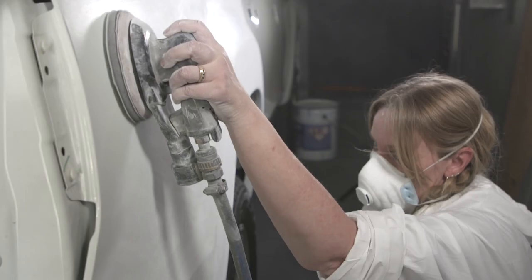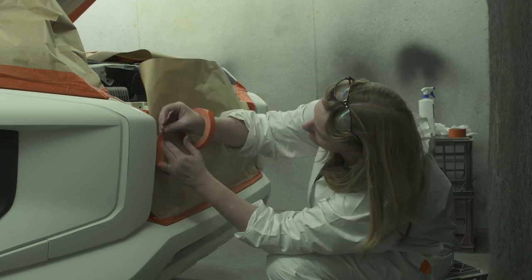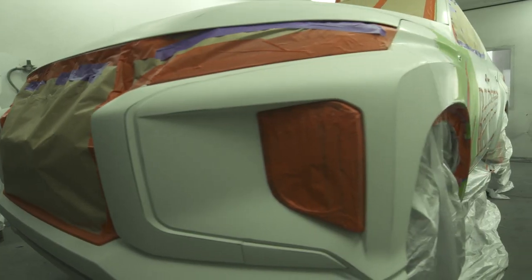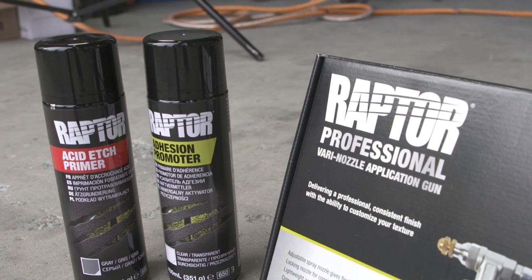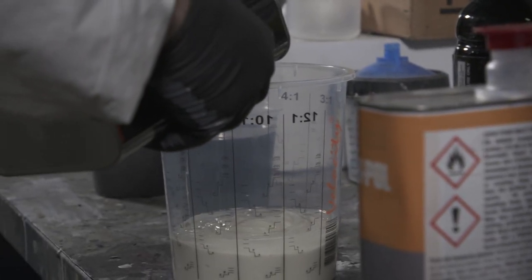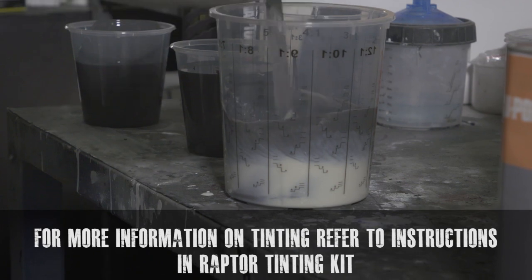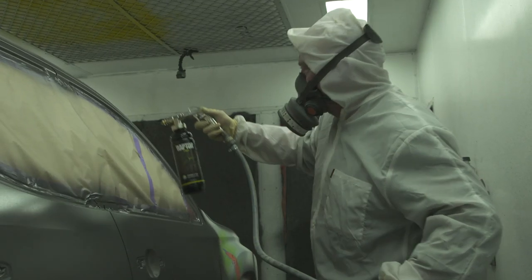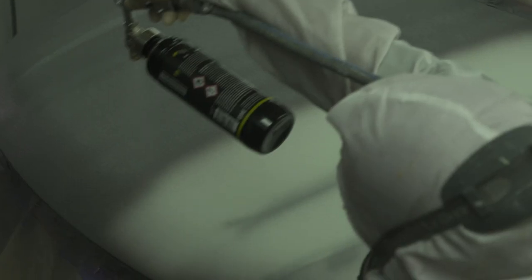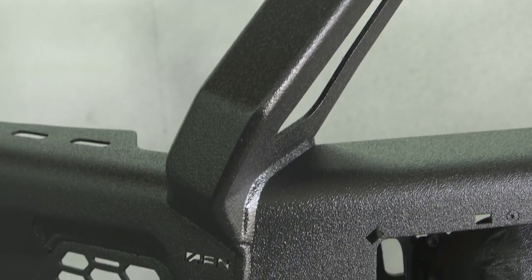Just like the bar work, step one is to strip the car down and tape up anything you don't want coated, then get to work preparing the surfaces. For auto paint, powder coating, and plastic the process is the same as bar work. For bare metal or bare aluminium you need to prime it with a Raptor acid etch primer, which comes in an aerosol can. Raptor comes in three variants: black, white, and tintable. To spray Raptor any colour you want, use the tintable kit — you need to mix up the colour separately. If you're using one litre of Raptor you'll need 50 ml of Raptor-compatible colour, then add that in with your hardener and you're good to go. For the Triton we used two-pack tint.